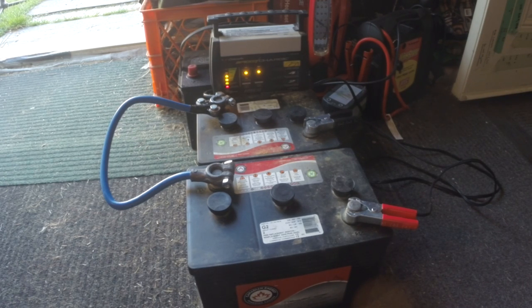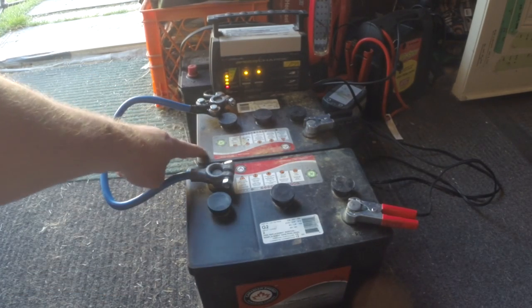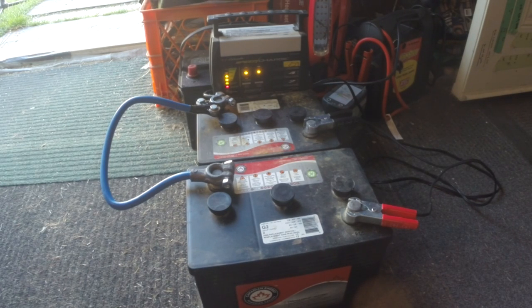On my multimeter it was like 0.04 milliamps — essentially zero. I tried to charge it but it was so low that none of my chargers would even attempt it. They're smart chargers, and they won't put out a charge if it looks like it's not connected to a battery or not a good one. This is the original six-volt battery that was in the Merc before I bought the newer one. I was able to charge that one because it had some residual power, and it was in the trunk. After charging it up, that's the one I've been using in the Merc.